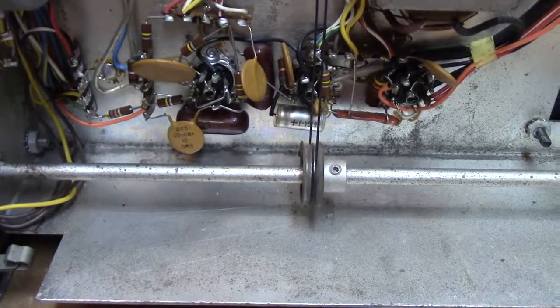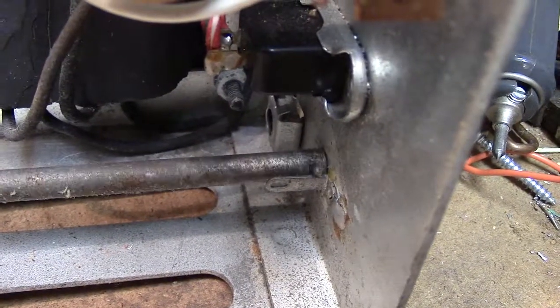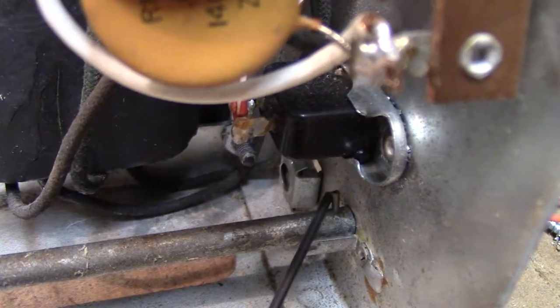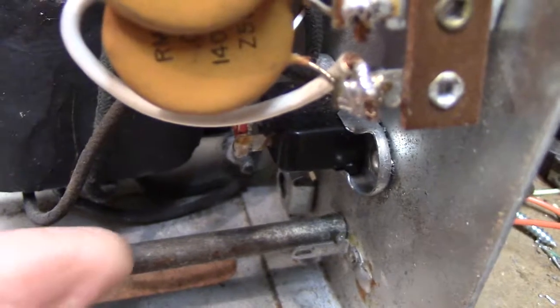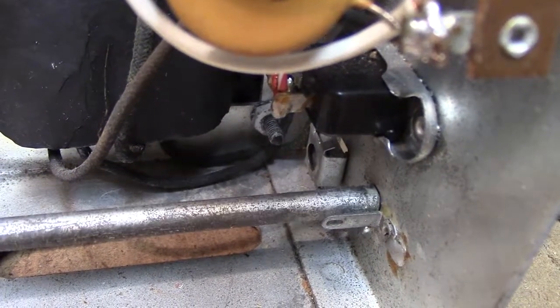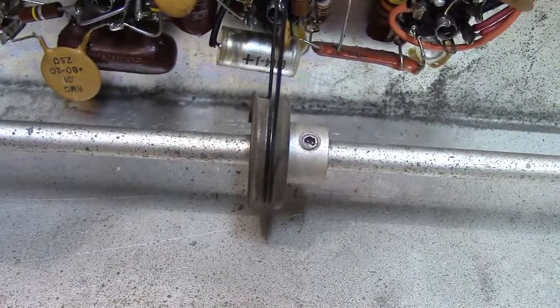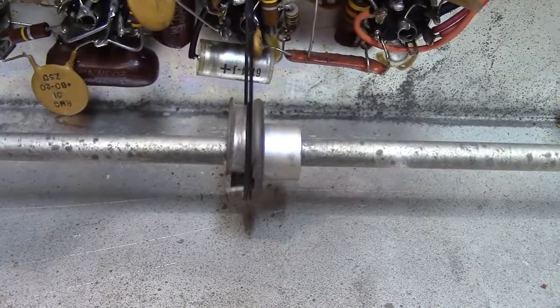These are problematic because the string can slip down here on the pulley. When it slips, that puts the knob completely out of phase — you may have adjusted it properly at one time but then when it slips it's out of adjustment. The travel of the pulley is restricted by a pin that hits a little stud and limits the travel in each direction, so you can't spin the shaft around and around. You get frustrated because the string is slipping and eventually that string may even break.